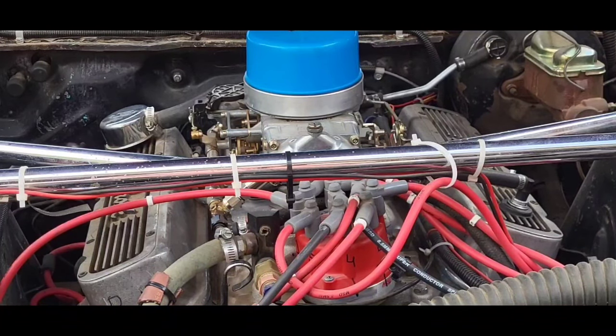Anyway, this motor, there's something wrong. Looks like valve train damage, although I can't ascertain the damage until I get the valve covers off, but that's next. I hope it's just bent push rods. Hope everything kept clean. It only popped once. I shut it right off. I knew it was no good.